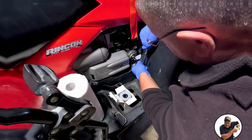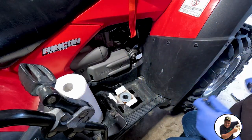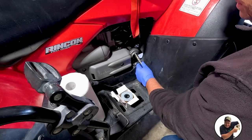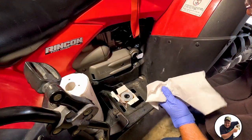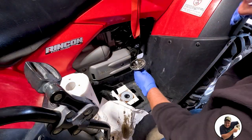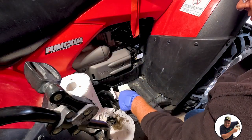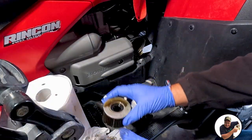Now we're going to change out the oil filter. We'll need our socket again — loosen that off, then take off the ratchet portion and loosen by hand. There will be some oil that falls down, which is why we put the pan under before we started. Use a pick or pin to break that seal. There it comes — be careful not to lose the spring, it's very important for the new one. Ease that filter out; as you can see mine is nice and dirty.